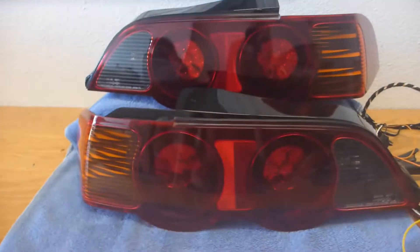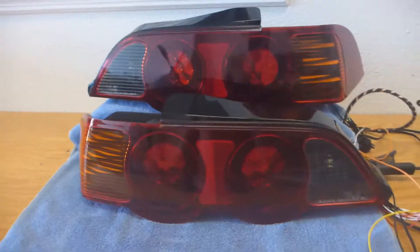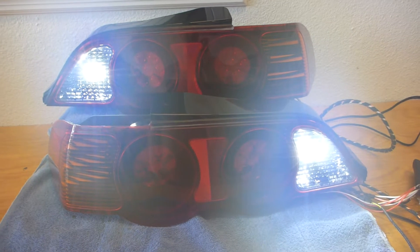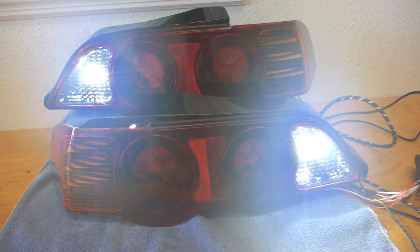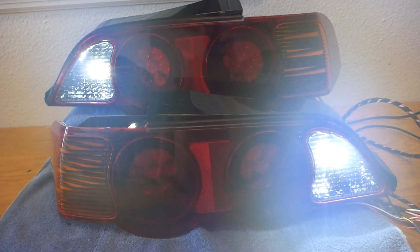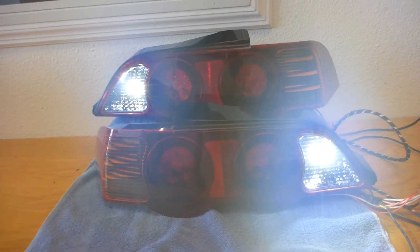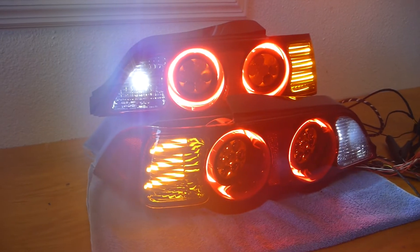This is what our turn signals are going to look like — three strips blinking in the amber light color mode through an amber lens, so it's really bright and looks really good. Alternatively, he could wire the turn signal to also activate the halos on the dim position, but this is how I would do it and I think it looks great. For the reverse lights, these are just LED replacement bulbs — nothing fancy. A lot of people are concerned about painting reflectors and whether you still have usable light output. The fact of the matter is, as long as it's a high quality glossy paint and not some satin black spray paint, it's extremely shiny and will definitely project light out. No concerns whatsoever.